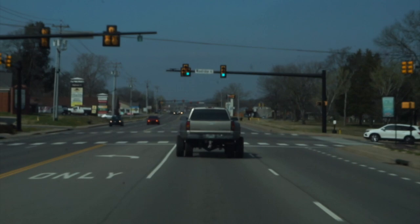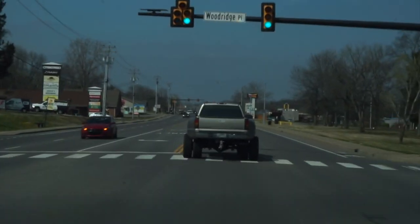We've got to change the oil in this and change both the fuel filters in it. I'm not sure if you can hear it on video, but the tires on this thing have gotten really loud. They've gotten all cupped really bad and it rides like crap, shakes really bad. So we're gonna swap the tires, put the front left on the rear right, vice versa, see if we can get them to even out some.